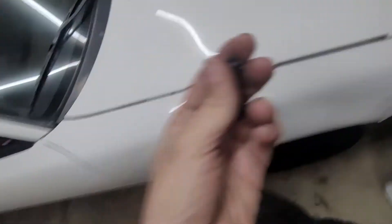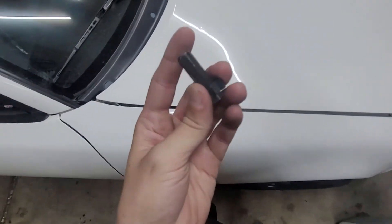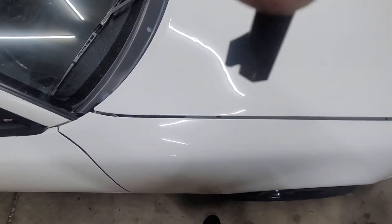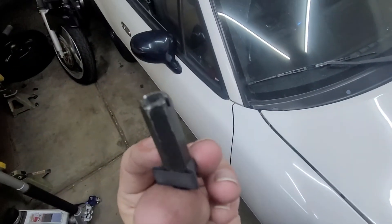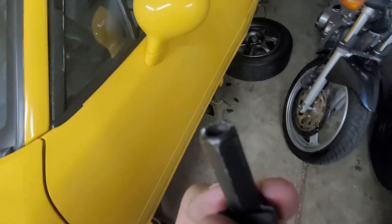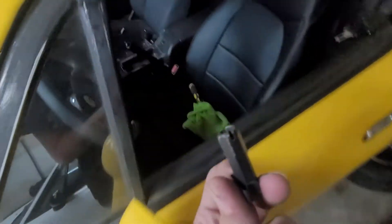Let me focus in on it. This is the handbrake adjustment nut, and when you're spinning it, there's this little clip that you should have, and it's going to keep slapping against the handbrake making a clicky-clicky noise. So you just put a big flathead in the top here and spin it until it's off. And you want to make sure you have that last nut on the bottom side of the car still on, just in case you're spinning the entire cable.